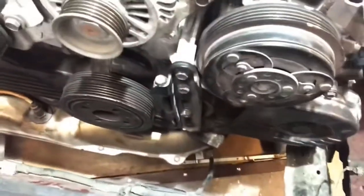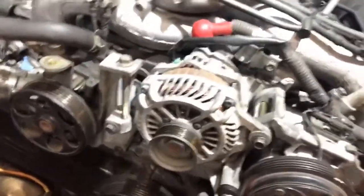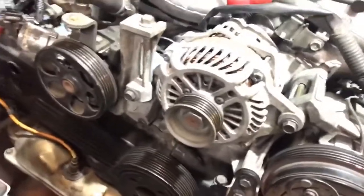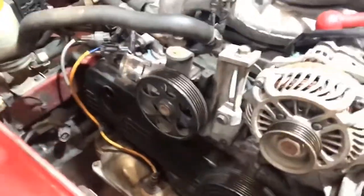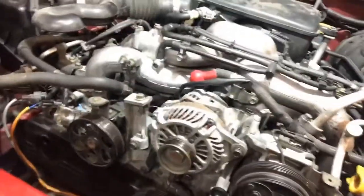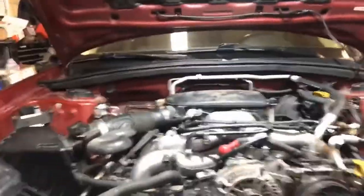Resolving it means taking the fan guard out — I've taken the radiator out but you don't need to. There are two 12mm bolts to remove and then this whole metal black bracket will come off. Take all these belts out, and before that you need to take off the power steering and alternator belt as well — there are videos on YouTube for that. I'm picking up in this video once you've gotten to the point where the belts are all taken off, just to show how easy it is to replace this pulley.